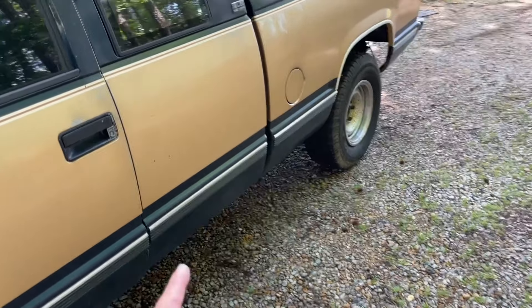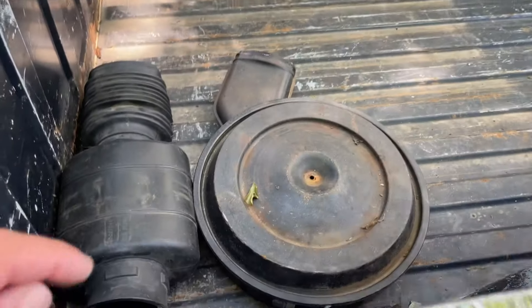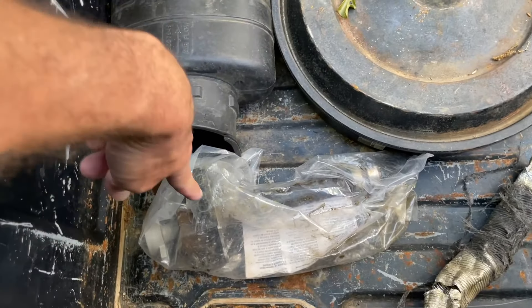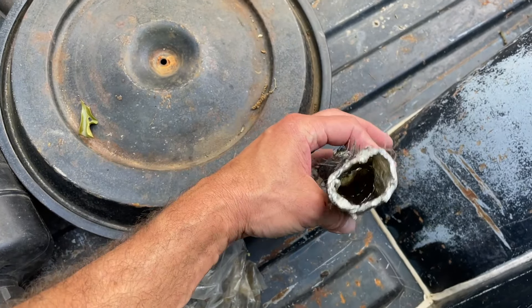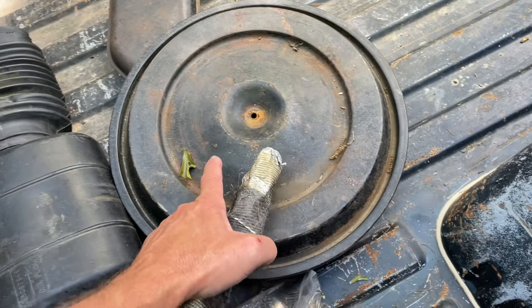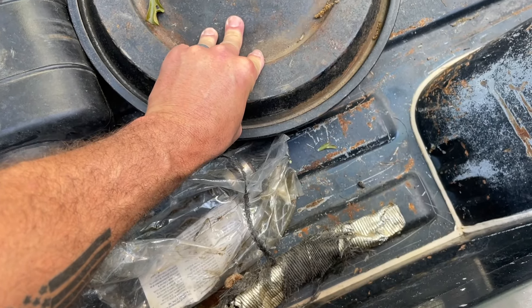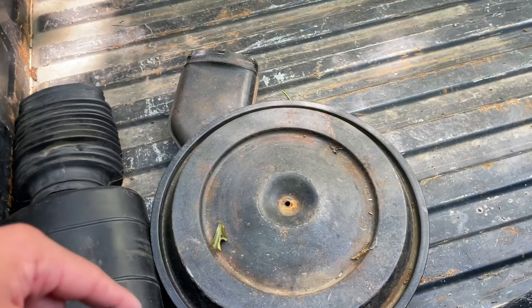All the molding still on it. There's that factory air box and the snorkel tube that goes to the fender. It looks like the distributor's been changed at one point. This is a slinky hose that goes on top of that manifold to the air box so you can get warmer air sooner, I think is the idea — so your engine runs good in cold weather.